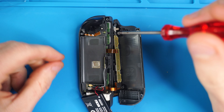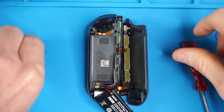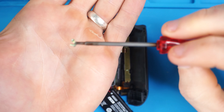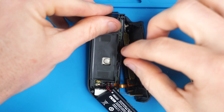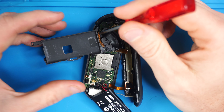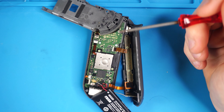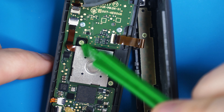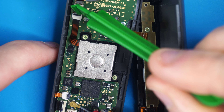Take your Phillips head screwdriver — it's a P00 I believe — and there are three screws to take out. These three screws are a gold color. They're shorter than the black screws we took out earlier but longer than a silver colored screw also in the Joy-Con assembly. Now pull this antenna off and pull it to the side out of the way. Grab the battery tray — the ZR ribbon cable is attached to the circuit board, so rotate it on the axis of that ribbon cable and flip it up and out of the way.